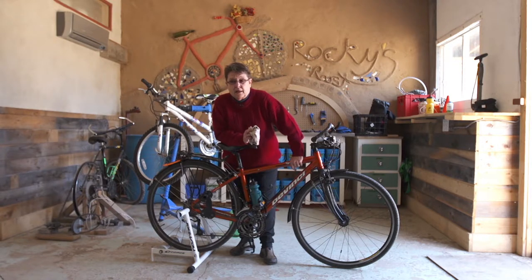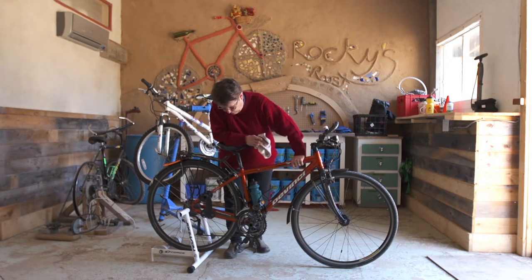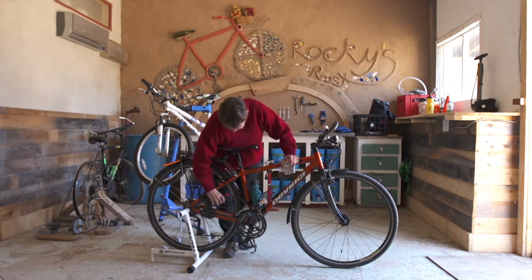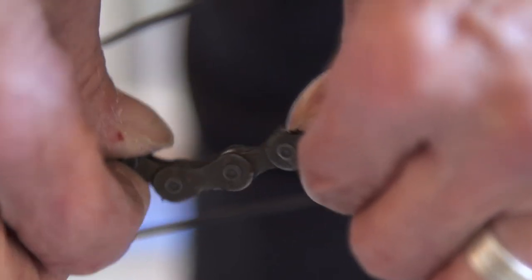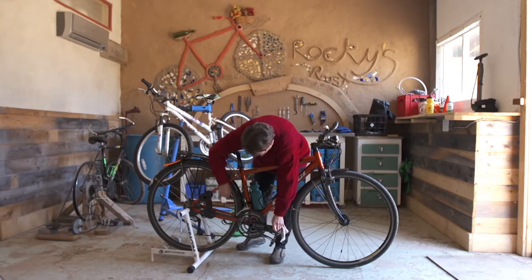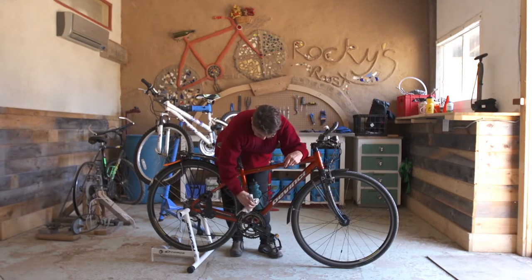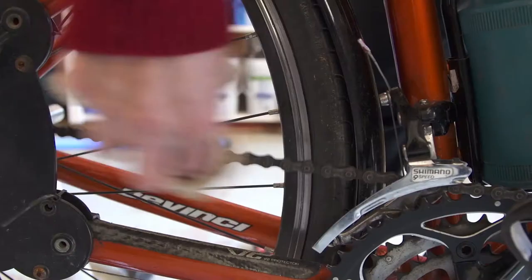If you don't have degreaser and you've got WD-40 around, you can use that for taking the gunk off your chain, but it's not the best thing. Don't be fooled that WD-40 is a lubricant — it's not. It's actually going to take the lubricant off your chain. Once your chain is clean, take your bottle of lubricant. The idea is to put lubricant into the moving parts — they're almost like little hinges. Instead of just smearing it all over, put a drop of lubricant at each one of these moving points, and as you do that, move your chain all the way around. When you've finished, take a rag and run the chain until you're happy the lube has gone all the way around, then wipe the excess lubricant off.